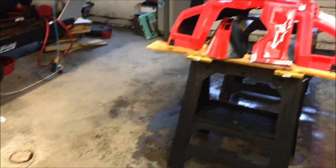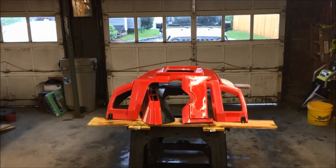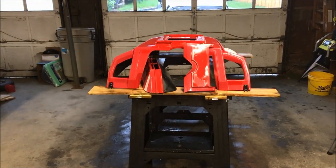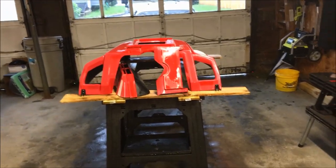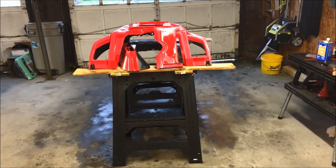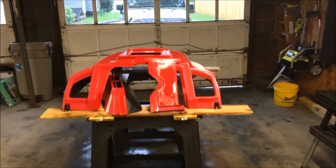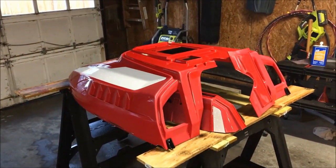I've taken the leaf blower and blown out all the dust out of the garage today. Tomorrow we'll construct the makeshift paint booth using simple plastic drop cloth, wash the hood down one more time, clean it with a tack rag, bring it into the booth, and get it set to paint. We'll also hose down the floor so any residual dust doesn't get kicked up. That's it for today — leave any questions in the comments and thanks for watching!